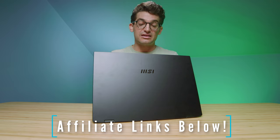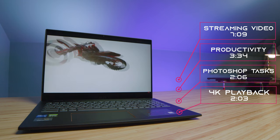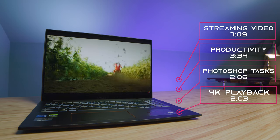If you're curious about the exact pricing and availability of the MSI Summit E16, you can find that link in the description below. One area I wasn't able to test during the unboxing was battery life, and this is one area I wish was better. I believe the reason is there's no MUX switch available on this laptop. A MUX switch lets you turn off the dedicated GPU and only utilize the CPU for tasks like streaming video or productivity work, which would have substantially improved battery life. My battery tests include streaming YouTube, the Passmark productivity benchmark, 4K video editing on loop in Premiere Pro, and the Photoshop Puget Systems benchmark on repeat until the battery dies.